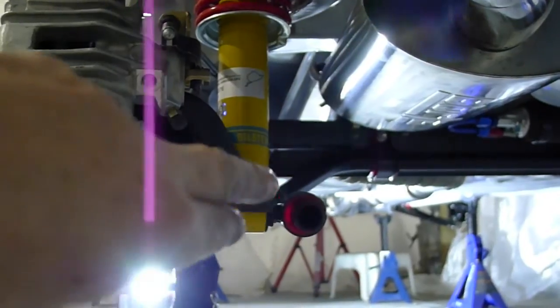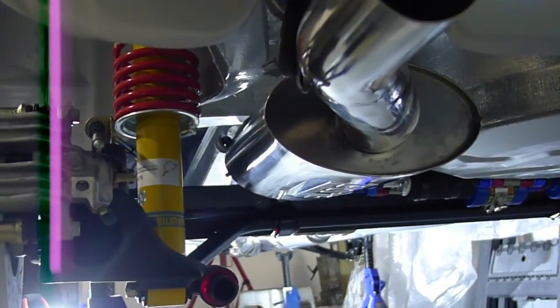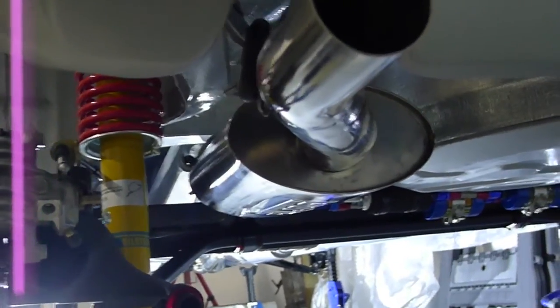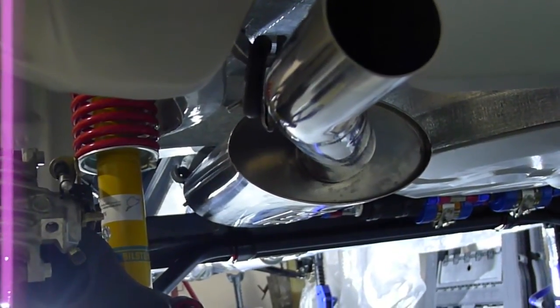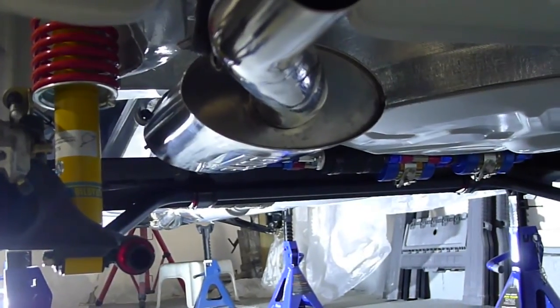I've got a hanger worked out really well at the back. The trick is that Auto Tech hollow anti-roll bar — it's going to be pretty close when the suspension is fully loaded to touching the side of the muffler. It looks like it'll have just a tiny bit of clearance; I may have to move the muffler over slightly or give it a bang with a hammer to make a small dent. Anyway, trying to put a big exhaust system in an old Mark 1 is a tight fit, but the Tectonics system works beautifully. I've tweaked it with the V-band clamps and the custom tailpipe, but basically it fit really, really nicely, and I think it's going to be great. I'm glad I got that front brace on the header for support — it's perfectly positioned and doesn't want to move.